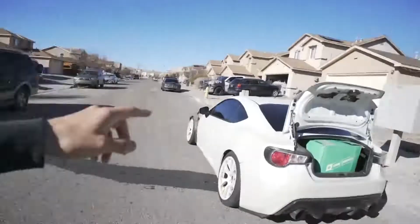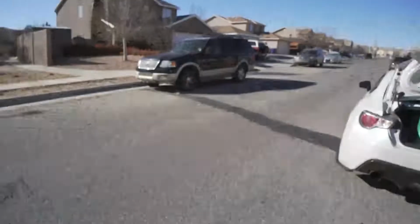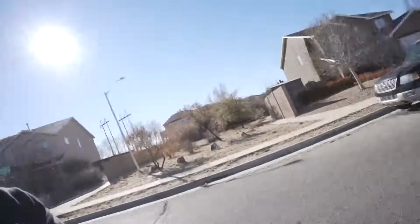My reasoning for that is, one, it's a lot cheaper. And two, the coilovers that are on this car have adjustable dampening and they have camber plates. If I would have bought the Airlift bags, they would have had the same exact thing as these, but I'd have spent double the money. Could have just gotten the Truheart bags, but I didn't want to, because they do not have adjustable dampening and they do not have adjustable camber plates. So this just made sense.